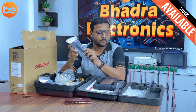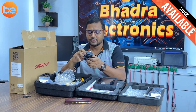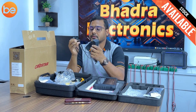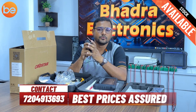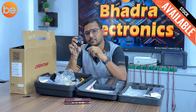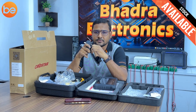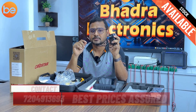The quality is very good. Next is the 12V adapter — the wire length is okay, sufficient for bench work. You do not need to connect any adapter in OBD mode. But if you want to work in bench mode, you definitely require this one — because when you connect on bench OBD you will not get 12 volts. For that reason you need to connect 12 volts power supply externally. It's mandatory.